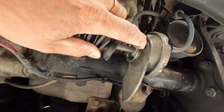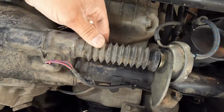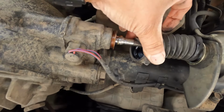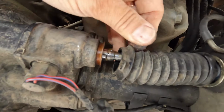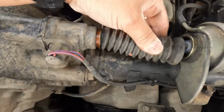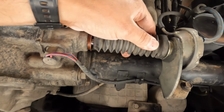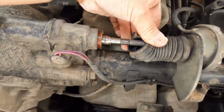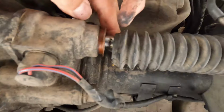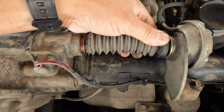we don't have that much water, but right now when I pulled it, we did have a little bit of moisture. So this one has a little tab that you pull out, and I could see it's got some grease from last time when I added grease to it. So I don't see big puddles of water. I did see a little bit of moisture there when I got this thing loose, but it's not a big deal. So this is a good opportunity to pack it in with some grease again, right in here, and then just put it back together as it should be.